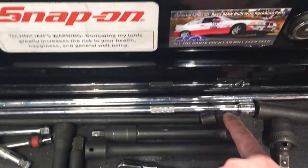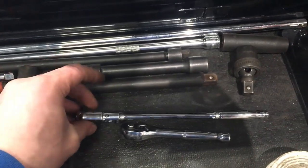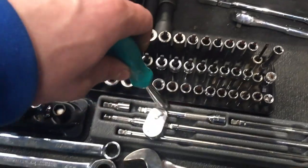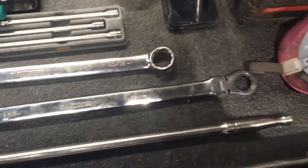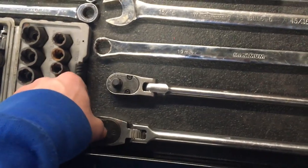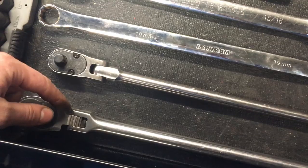I've got the long Steelman Pro half-inch to three-eighths swivel extension — really nice, works really well. This ratchet is awesome — you can buy this at Princess Auto, it's a Power Fist quarter-inch drive, really good for getting into small spaces. This Snap-on ratchet is my favorite though — you can come up on a fastener and twist with your fingers to ratchet something into place without reaching for a screwdriver. I got a long box end 19mm for serpentine belts — 17mm is also applicable for serpentine belts on Hondas. This three-eighths Snap-on ratchet is a long one, works really nice. The half-inch Princess Auto one works pretty much just as nice and is about a fifth of the cost — so if you don't want to shell out the cash, go to Princess Auto. I've got half-inch sockets: 17 and 19 in shallow, mid-deep, and deep; 22mm; and my half-inch mid-torque impact gun which works really nice.